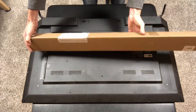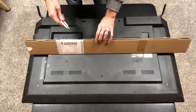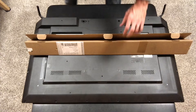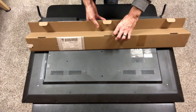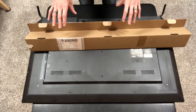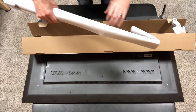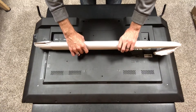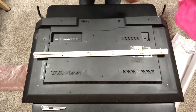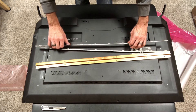Here are my new LED strips. Looking at the shipping label, this was shipped in June of 2020, so I've had these for a while, but I knew my repair wasn't going to last long. These came from shopjimmy.com — no affiliation, but they've got really good parts listings where you can search by make and model number. So before I open the TV up I'm just going to make sure these look good. Interestingly, these appear to be remanufactured strips — I was not aware that's what I was buying.